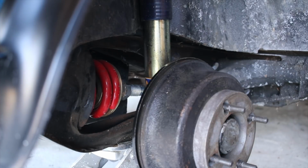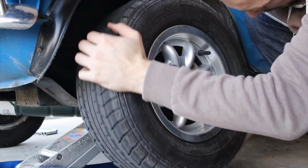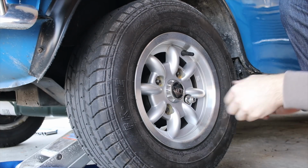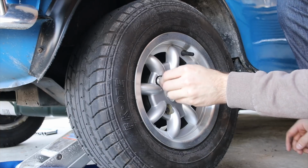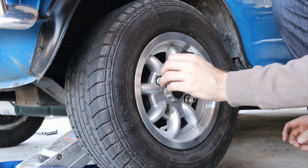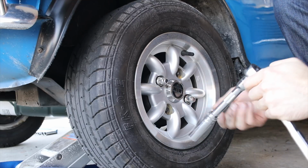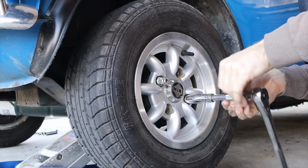So it's free right now. When I put the wheel on, it should remain free. Now you can usually test this by just putting 2 of these nuts on. That'll sandwich it down and allow you to test to make sure that the parking brake engages and remains disengaged when it's not turned on, or when it's not pulled.